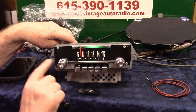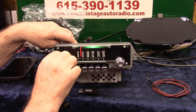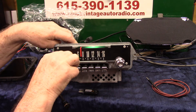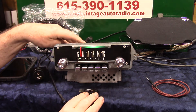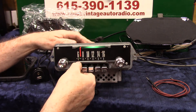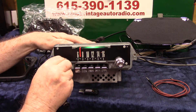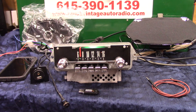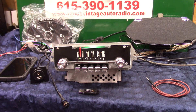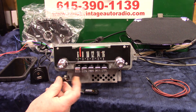You can do it either way — you can back this up and go clockwise twice. Fader adjust, same way. Fader set. We want to stay right there. That's how your fader works. Your balance — I wouldn't worry about it because this one's so close together as stereo. You'll be fine with your balance. Balance is counterclockwise or two quick pushes and a hold.